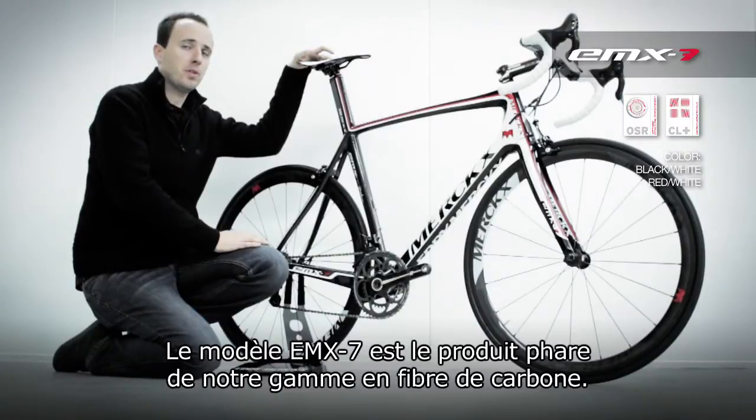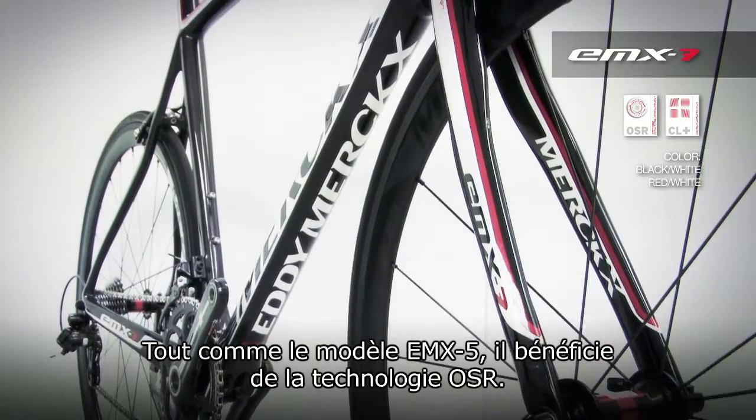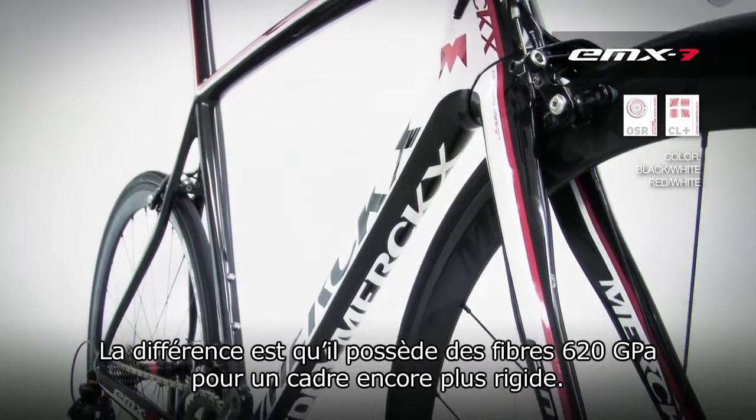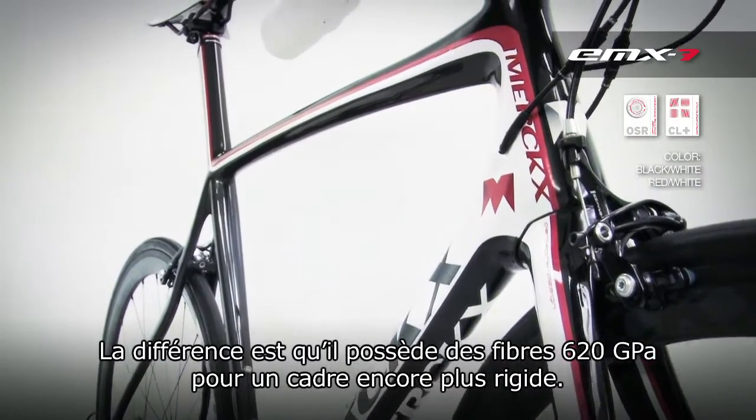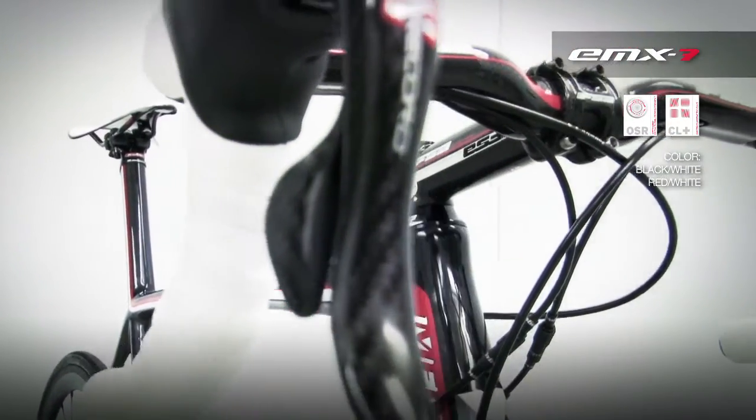EMX7 is a flagship of our carbon fiber range. Just as the EMX5, it also uses OSR technology. But the difference is it's using 620 gigapascal fiber to get the extra stiffness in this frame.